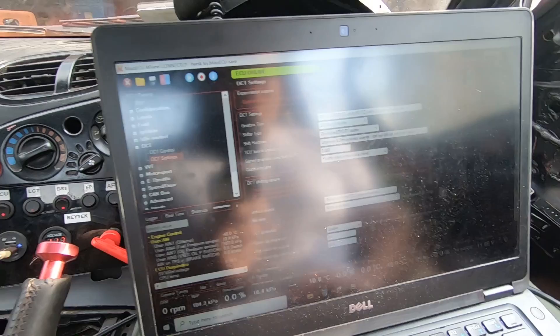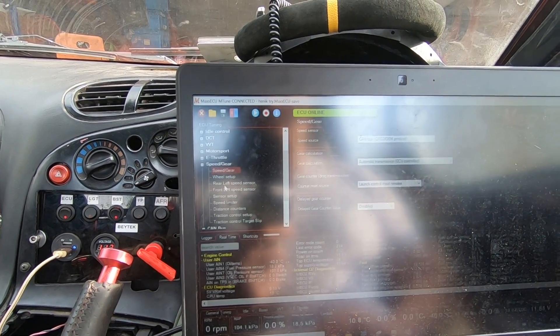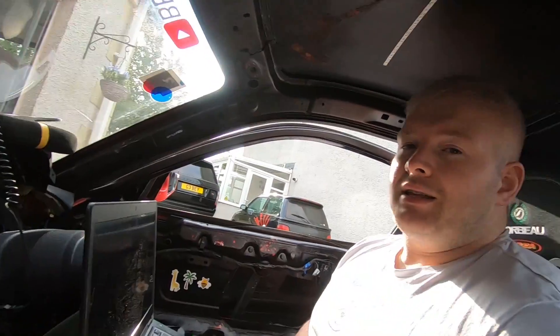I'm going into the settings here to see what I need to do for my wheel speed stuff. Setting up my wheel sensor - I've got a rear left with 38 teeth because I'm using a 350Z diff which has 38 teeth on the rings, and the front Mazda one is 44 teeth. It doesn't even need to be the same amount of teeth between front and back and the Max ECU is fine with that. For speed source I'm using CAN bus - the TCU will send the speed to the ECU. I've just got some DCT settings to soften up the takeoff, because I'm getting to the stage where I can start refining it - so when I select the gear, it won't move until I put my foot on the throttle and it starts pulling away. Just trying to smooth that out basically.